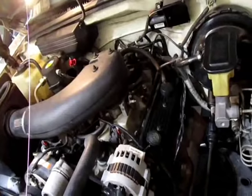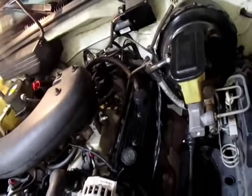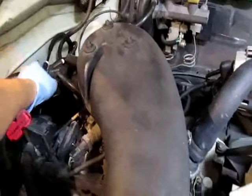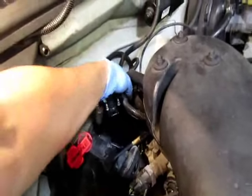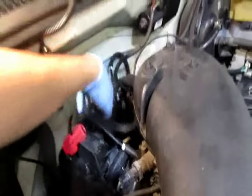We're going to be trying to remove, reinstall, and in the middle of all that, rebuild the distributor on this pickup. Over here I have all the parts inside, but in order to do that I first have to take the distributor cap off these wires. I mark them on these things - I would recommend everyone do this if you have an old Chevy. Get these little wire markers and put them on each wire, makes it a whole lot easier. You just pull them all off, and you can note the order beforehand. Find each wire very easy, makes R&R on your distributor cap cake.